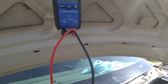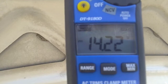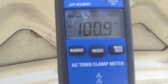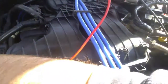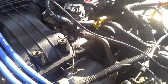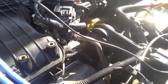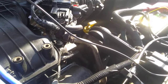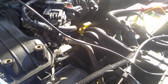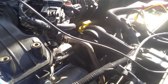We're reading nothing — but wait for it to click on. This low pressure switch is definitely bad. Like I said, I've already checked the charge on this vehicle; I don't have my compound gauges with me today to show you, but I will in a future video. I'm going to go ahead and show you how to troubleshoot the pressure transducer on the high side as well, in case that may be your problem.